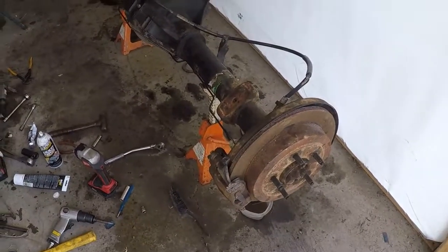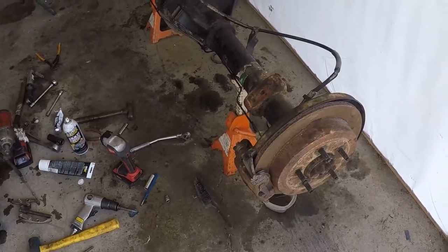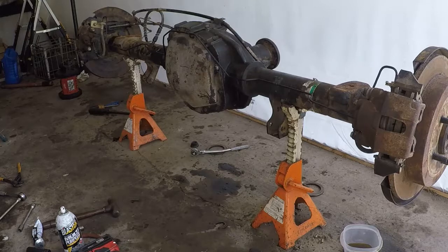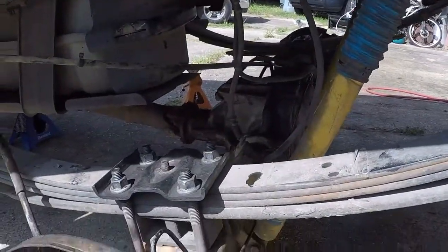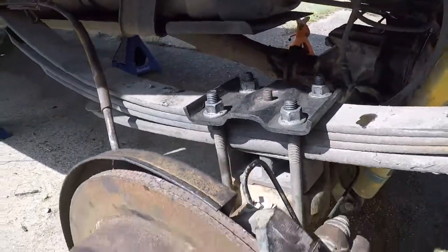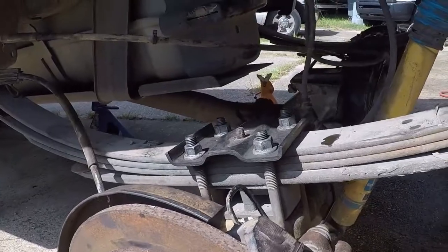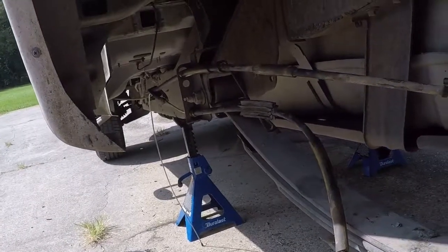She's basically back together. I'm not terribly happy with the emergency brake lines, but worst comes to worst, if they don't free up enough to work, I'll get them out of the junkyard for a couple of bucks. Now I'm going to get the motorcycle jack, lift that thing up, see if we can get it underneath the truck. She's in — brake line hooked up, vent hooked up, drive shaft went in no problem. Everything matched as far as the U-bolts and all the spacing, everything looks pretty good. We just bled the brakes. The only thing I don't have completed yet is the emergency brake, because the one on the other truck was not complete.